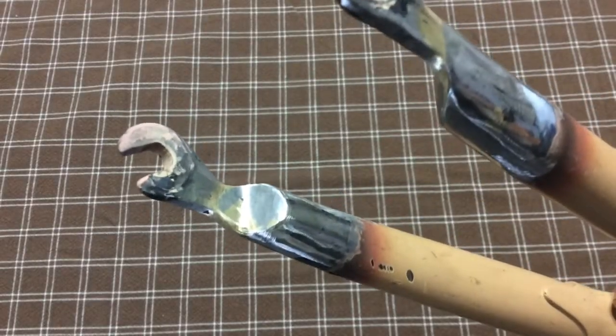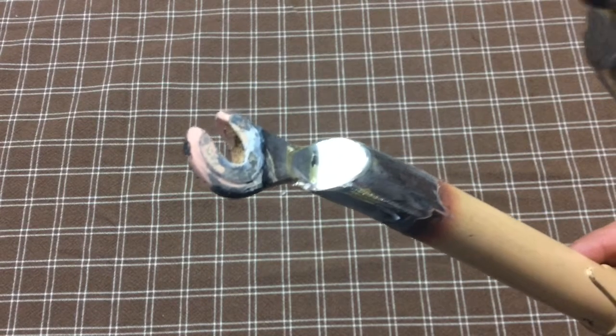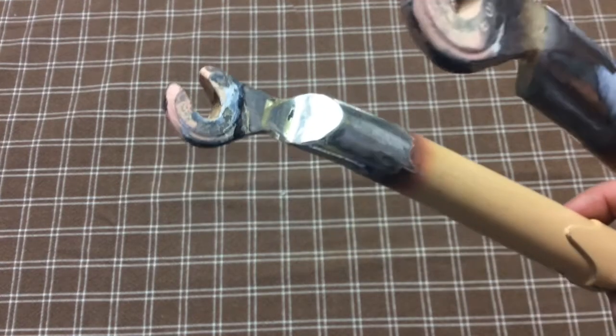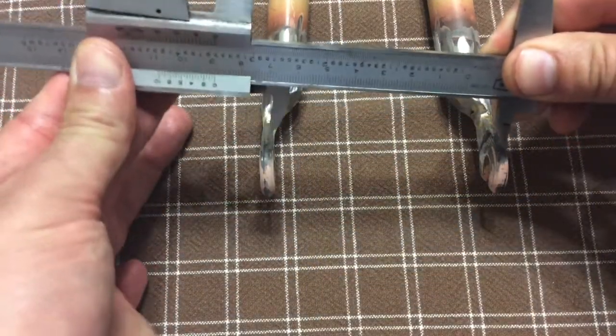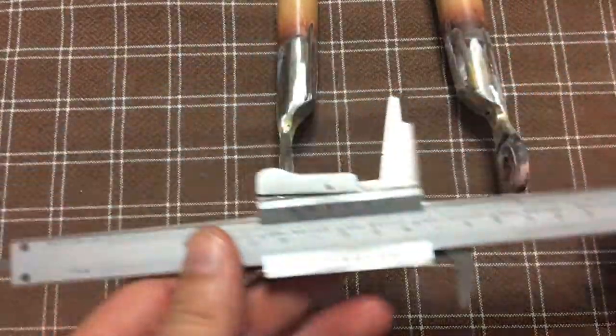Now this fork is for a recumbent bicycle project and it will not attach to a wheel — it's for the rear upper seat brace. This technique would work if you had a longer fork and did not have to shorten it as much. You need to make sure that the inside-to-inside dropout distance is 100mm, which is the standard dropout distance for front wheels. Rear wheels vary depending on the wheel, but the actual distance we have from inside to inside here is 85mm.